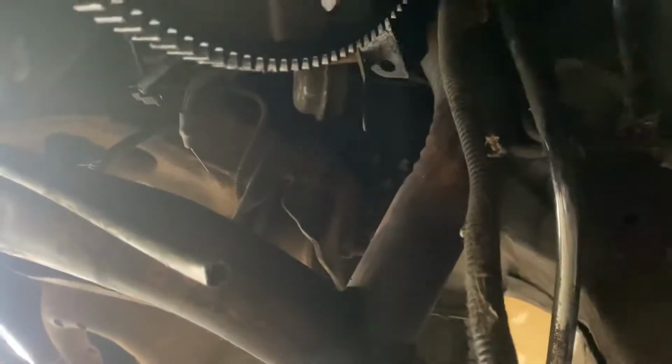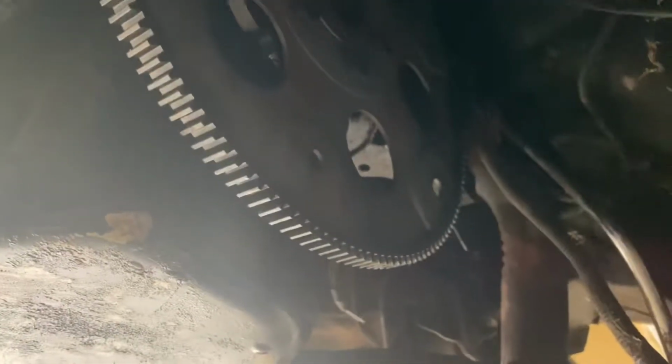All right, so I don't know if you'll see it, but I got this driver's side downpipe unbolted. Surprisingly, neither of the bolts broke. So now I gotta do the passenger side. Another thing I remembered is that metal line that runs to where the cat was. That needs to be cut up here around that. I'll just take a grinder to it and snip it off. Then we gotta get the other side downpipe off, drain the coolant, and I think that should be the last step before the car can go back on the ground.